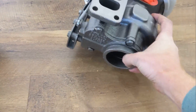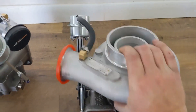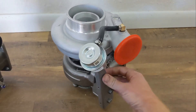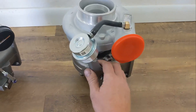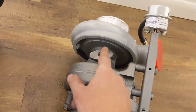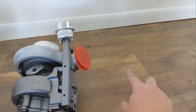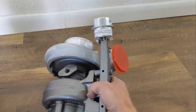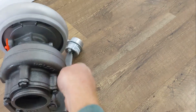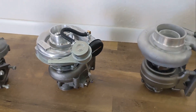You'll also need to clock this — preferably where you have a vise. Put a towel on it and pinch it in the vise. It has ring clamps right here, so you pinch this and that allows you to rotate the compressor housing. The flange needs to be pointing down because picture your manifold here: the adapter comes up, it's installed, and you rotate the housing pointing down. It's not hard to do, but it is nice to have a friend helping you.